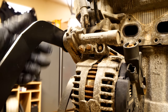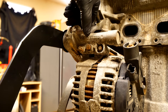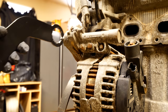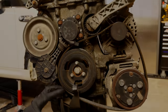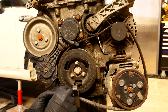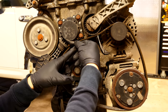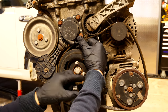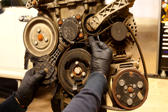Once you relieve the pressure from the belt, push the little pin in so it holds the tensioner up, then relieve the pressure and take this off — that gives no more slack on your serpentine belt. The friction wheel is still contacting the crank pulley, so we won't be able to slide the belt off. That's why we first have to pull on the little tab to put the friction wheel into service mode, pulling on it more to release the pressure.